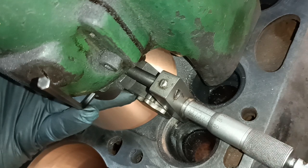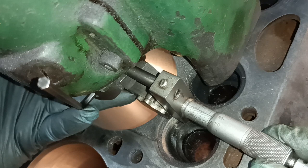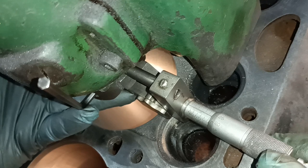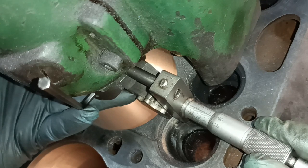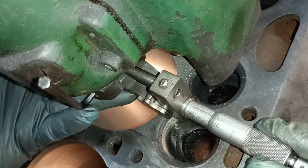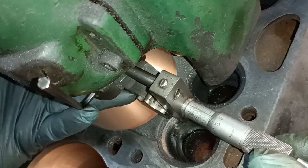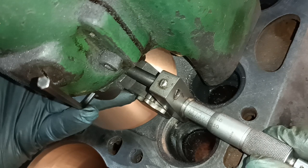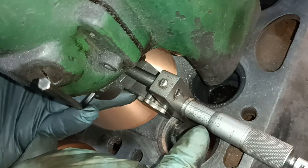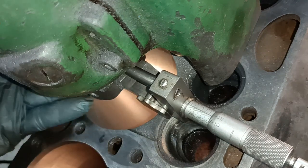But I know on this machine I have to kind of cheat it a bit. So I have to go like 2 thou less like that. So that will be my finished cut. And this cut is going to go here at 15. But I'm going to cheat it down like that. I'll go 2 thou less like that. Maybe I'll go halfway and do it 9 thou less. I'll cheat it by 1 on this cut, because the last cut was on the 5, so this will be 9 thou more, which is only 5 thou aside.